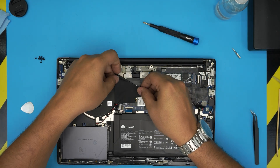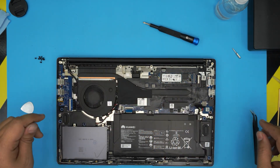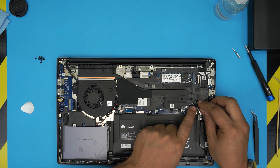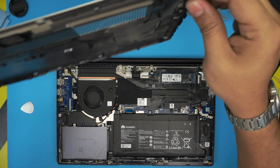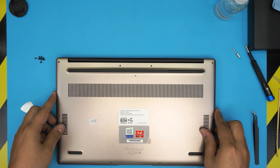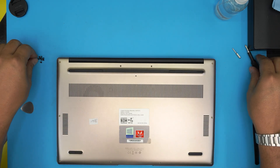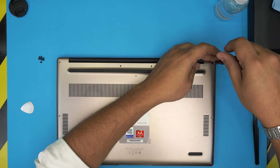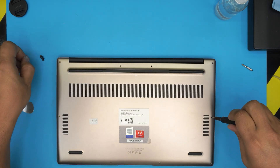Grab the kapton tape and place it right back on top. Then align the battery jack straight over the connectors, make sure it's properly aligned, push it in, and confirm you hear tiny clicks. Close the bottom cover by pressing the corners and back end until it clicks into place. Switch back to Torx number five and put the bottom screws back in — and you're all set. If you liked this video, click like and subscribe. Leave any questions or requests in the comments and I'll try to answer them as soon as I can.